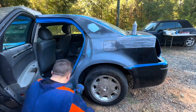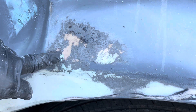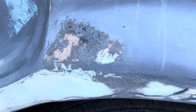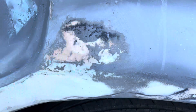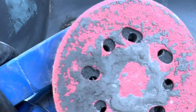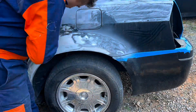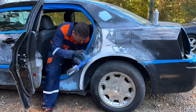I applied Bondo to that area and now I'm beginning to sand all of this. Look at that — it's just curling up, it's just so terrible. I thought three days would be enough for this stuff to dry. Is this primer plus paint not supposed to be sandable? Because it has messed up all of my work, so now I need to carefully remove all of it. I'm going through sandpapers like it's free — this is 80 grit sandpaper — and everywhere I try to sand it is basically just curling up on me. If I had the correct stuff, it would have made my job a whole lot easier.